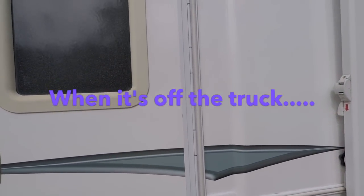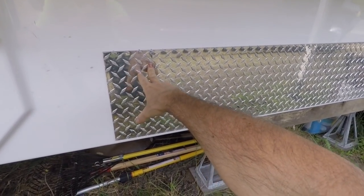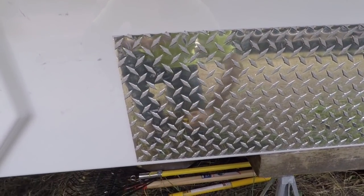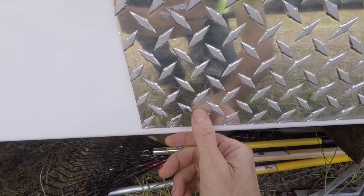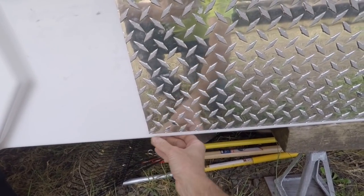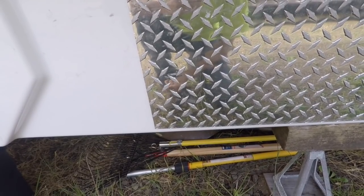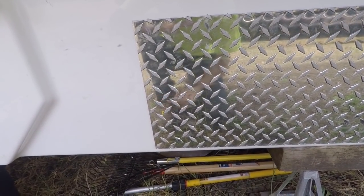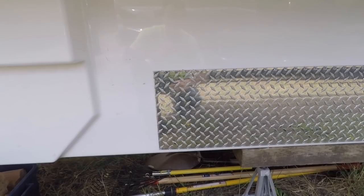I have this up on jacks right now and have it completely level. As far as the underbelly goes, I did install diamond plate skins on the outside. It's a really tight squeeze between the wheel wells and the camper — you can see there's a little bit of wear marks right there. But if I didn't have this on here, it could potentially be wearing on the fiberglass, which is not good. If you have a Northern Light truck camper, you're probably going to want to do something here. It doesn't have to be aluminum skins — it could be wood or any type of material. I chose aluminum because I didn't want to deal with any rusting or corrosion. These marks could be buffed out with a little rubbing compound.